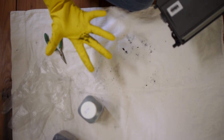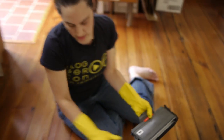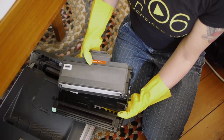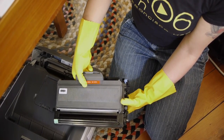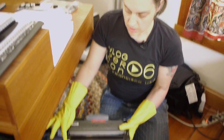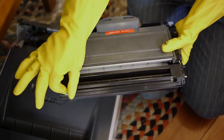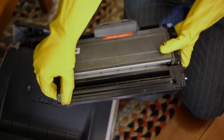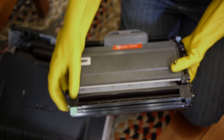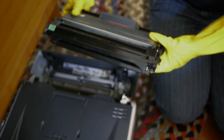You can see this area is a little messy and I got some toner on my hands, so it's easier to clean up if you keep a designated area that you'll do this in. Once you're done refilling, put the cartridge back in the holder. Another thing you can do on this model is there's a little button you can move back and forth to clean the head or the drum. Just make sure you pop it all the way back into place or it'll leave a line on the printout. Then put the whole toner and drum back in.